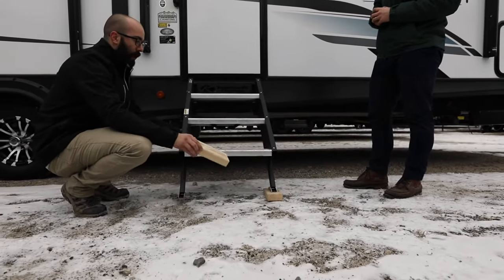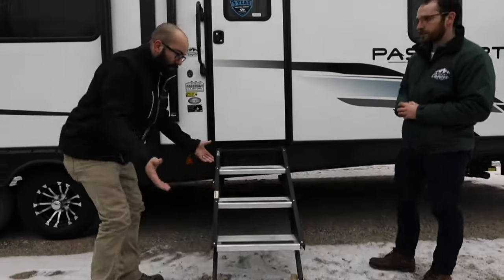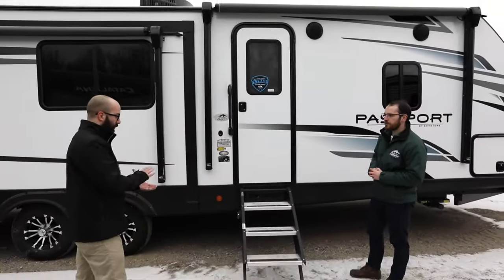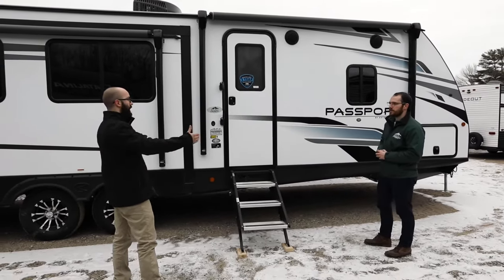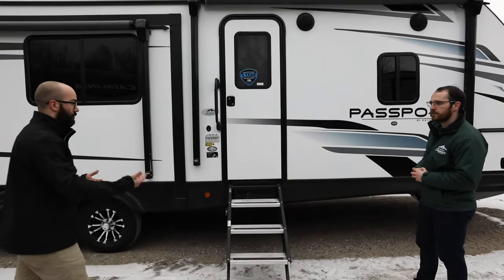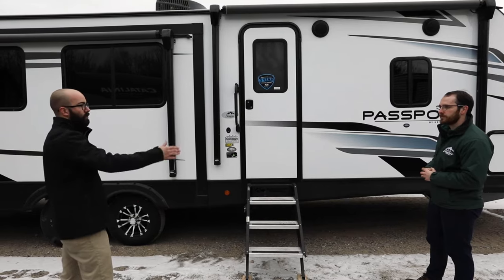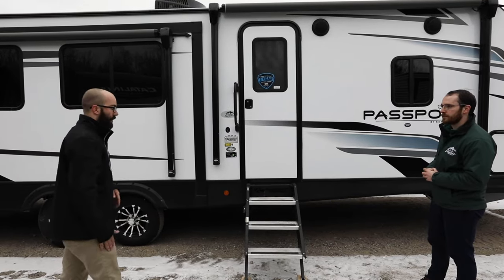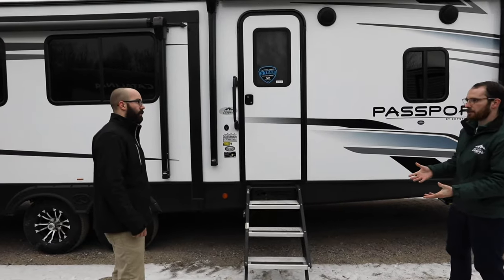A couple of cut-up 2x4s will do just fine in keeping these feet off the ground, so that way those feet don't sink in. The snow covers them, and then if the temps rise and then fall, you'll see ice build up on them and then they're stuck and you can't get them up. Same thing with the jacks, and even the front tongue jack — you want to make sure that you find a way to get it right off the ground. Those blocks are something that should be in every camper's kit anyway.